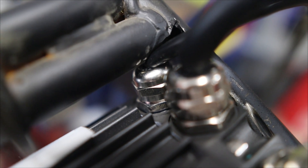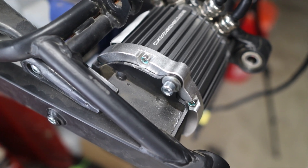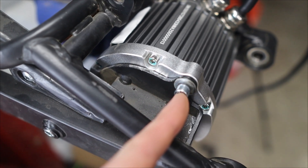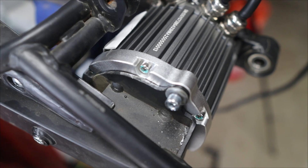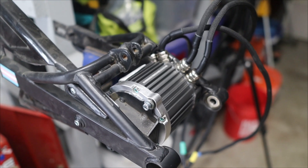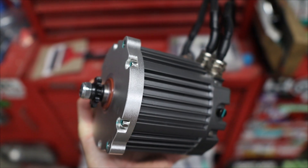You can see right there how close it is to the actual swing arm — that's how much clearance you're working with. The tightest spot is the very last plug for the hall sensors; it's a little bent, but I don't think it's going to be too big of a deal. Also, while this uses the same bolt holes as the original motor, it doesn't quite line up either. I actually had to take a drill bit, go up one size to make these holes a little longer so that they would clear properly. Otherwise it was rubbing right up against it such that I could probably get one or two of the three bolts in, but there was a risk of cross-threading things. So far, I'd say not exactly bolt-on — some hackery required. And you know what else? The threads for these bolts are helicoiled. Really pulling out all the stops to make this a direct fit, huh?